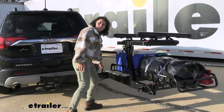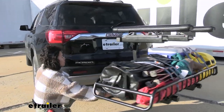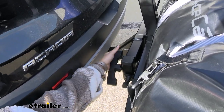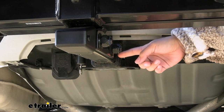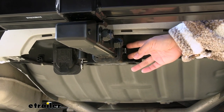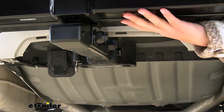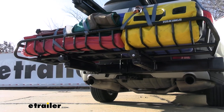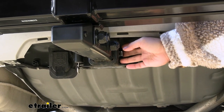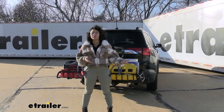Bring this back in — you have this little knob in the corner, lift that, grab this corner triangle, and this will help give you the momentum to run it up the ramp and tighten it back down with that large lever. It's important to tighten down that lever and the swing base, but also the anti-rattle bolt that holds everything in. This uses a 15/16ths wrench or a 24mm wrench. Be very careful with this and support the XO system with another hand to offset the off-balance design — you should be able to hand-tighten most of the way and just wrench it down for the last couple of threads. It is helpful if you like carrying the basket as a cart once you get to the campsite, especially when it's loaded up with cargo, as it can get pretty heavy.